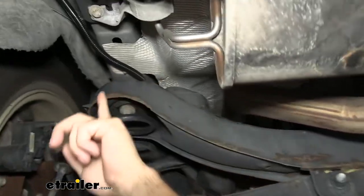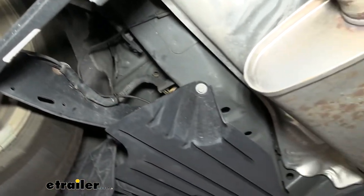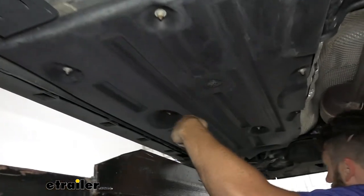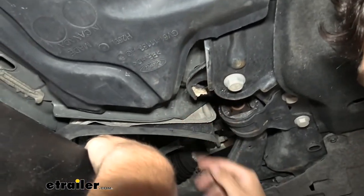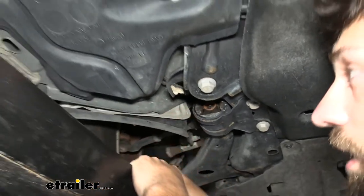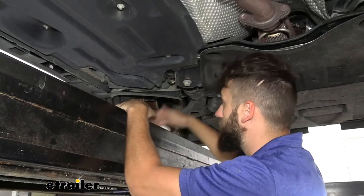Here's the path we took: on the first section near the heat shield, which is pretty sharp, we used some wire loom so it doesn't pierce the wire. Then we went up and over the rear subframe, using zip ties to keep it from falling down, and then up and above this panel. At that point, take a 10 millimeter socket and remove these three nuts so you can pull the panel down and sneak your power wire above it. Then go all the way to the front. There's a little pocket beside the lower control arm mount that allows you to fish the wire up into the engine bay where the battery is. If you're not sure how to get your wire up there, use a fish wire device — like a piece of airline tubing — insert it from the top down through the engine bay, then tape your wire to it and pull it up.